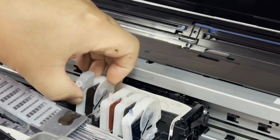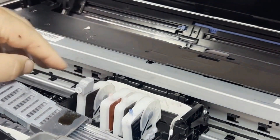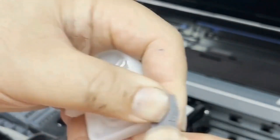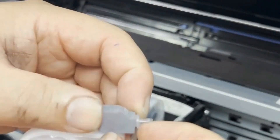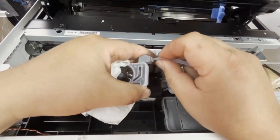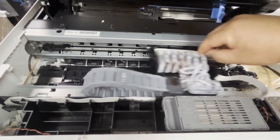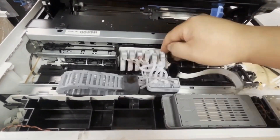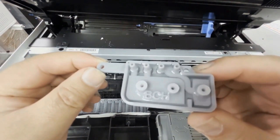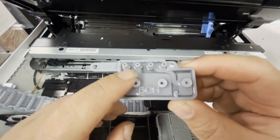Four of the dampers will connect to the clear tube directly. The clear tube is a C2 connection. For C2, we're going to use the elbows — just insert the larger end of the elbow into the damper. The smaller side is going to connect to the clear tube. Then there are two tubes used for white ink. The white ink tube is a C3 connection — basically this C3 connection is just two straight tubes. In the next video, we're going to show you how to insert this really good-looking assembly and connect all the tubes on your printhead. I hope you enjoyed this video. Visit us at bchtechnology.com or locally at Greensboro, North Carolina. Cheers.